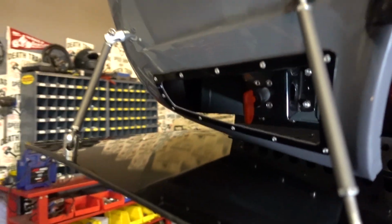So what else we got going on back here? You got a lot. Some fuel system, air fuel filter. It's serviceable. This is actually going to change when the radium comes on board. Basically, the fuel filter needs to be in a location you can service it easily without having to get into any of that. Right. Sub-mounted Braille battery that bolts on from the bottom, so if you need to pull the battery out, you do that. This is a master kill switch. It's a street car. Normally you would run this to the outside, so that anybody can see it, but I'm just gonna put a decal here.